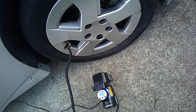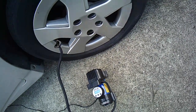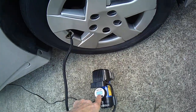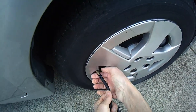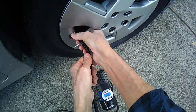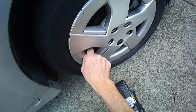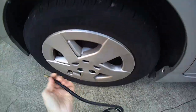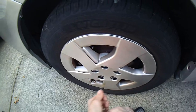We just hit 35 and it'll take a little bit to shut off on its own. Press M and it may store that 35 in the computer. Use your non-dominant hand to hold the hose and your dominant hand to spin this off lefty-loosey. You'll hear just a little hiss — didn't lose very much. Put the cap back on, then we'll do the back. For this car it's 33 pounds in the back — we can already see it's reading 33.